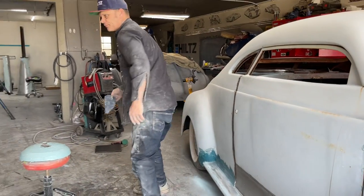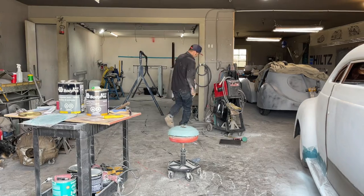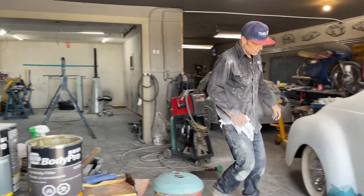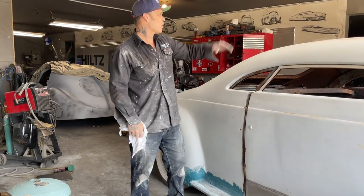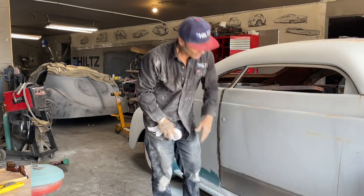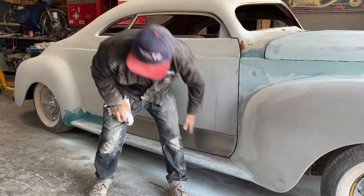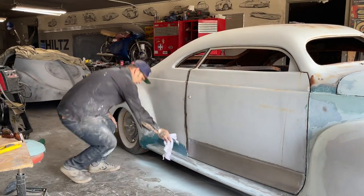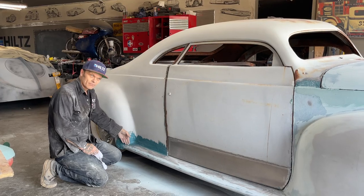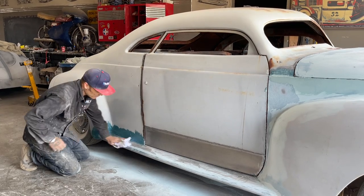I like to keep it sort of like a drywaller when I'm doing this stuff. What I mean by drywaller is I like to do one side at a time. If I was going up to do a corner, I'd try to do this side and both sides of the corner. I generally like to do one corner. If I come down here, I try to finish this and then I go onto this. I'll do all the way along here before I start going in here. It just kind of simplifies it, I guess. If you start putting mud on here and mud up in there, it makes it more difficult.